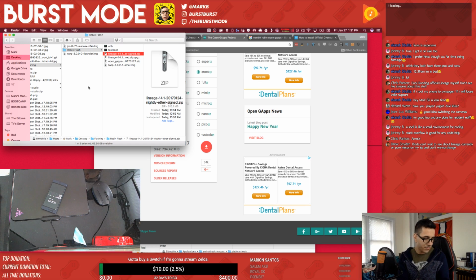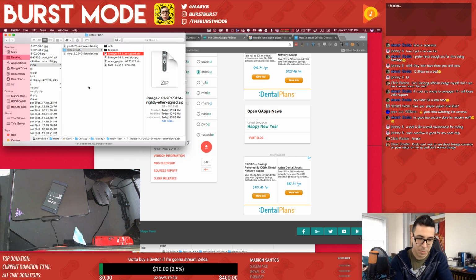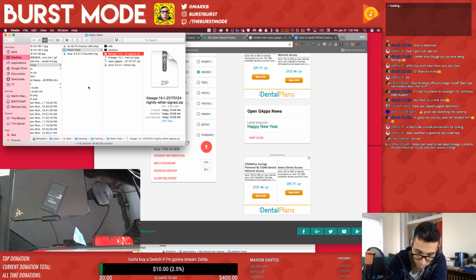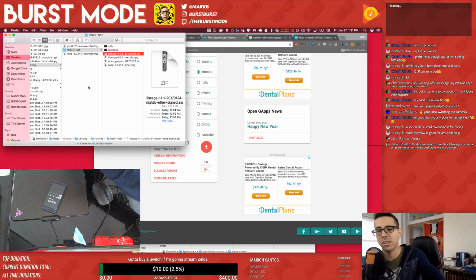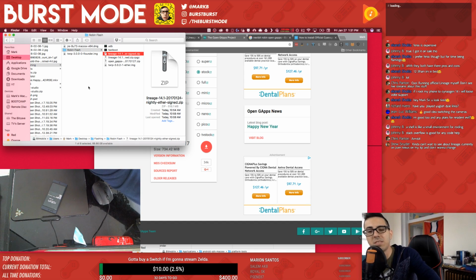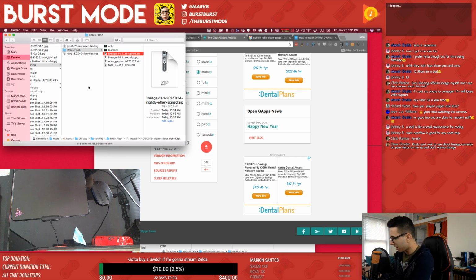So let's grab a cable and get this baby plugged in. On the device, if you haven't enabled USB debugging and you're in fast boot mode, it's possible your computer won't see the device. But there are times where sometimes even if you have enabled USB debugging, your computer won't see the device. In case that happens, and it might happen here, just reboot it, turn it off, and then back on. It should be okay if you've got USB.